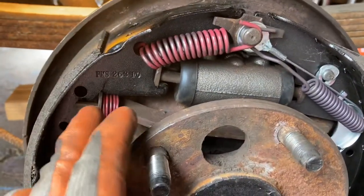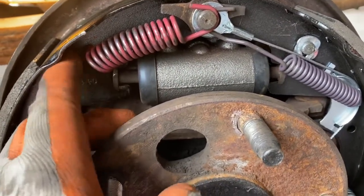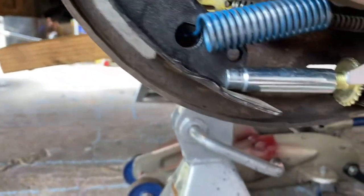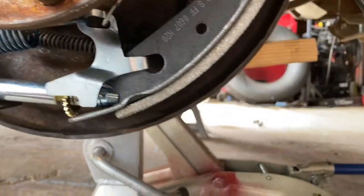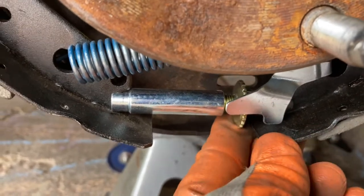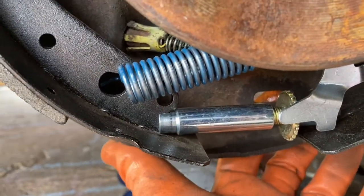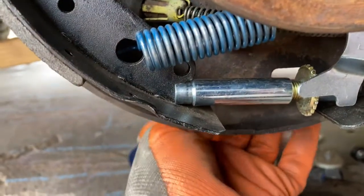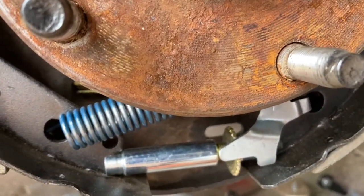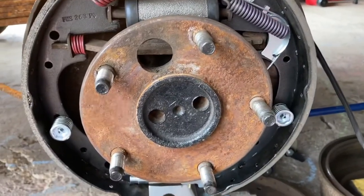Once that's done, make sure everything is aligned and in place. Take your front spring, place it in this hole, and load it out. When you go around the drum, everything should be symmetrical and in unison. This right here is your self-adjuster — it'll push out depending on how much play you need. You can use a big flathead or an adjustment spoon inserted in there to make that adjustment. Other than that, it's ready for the drum to go back on — this side is done.